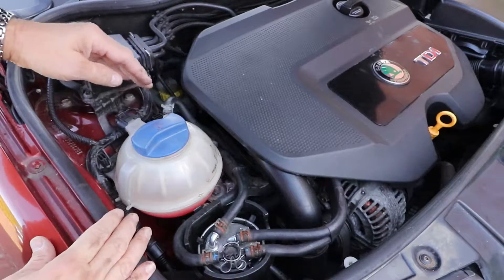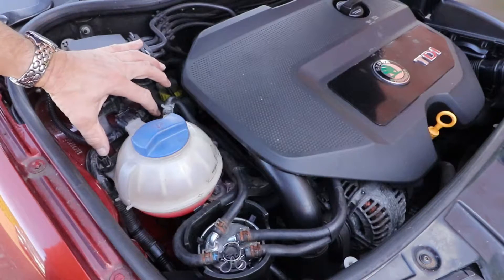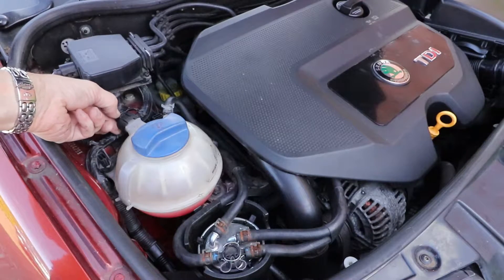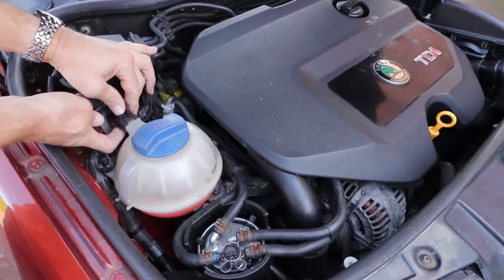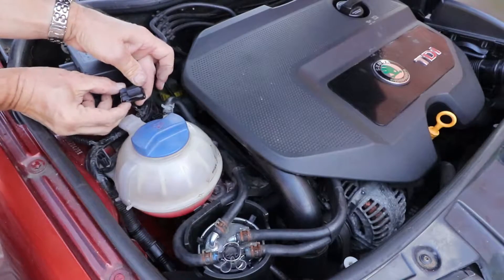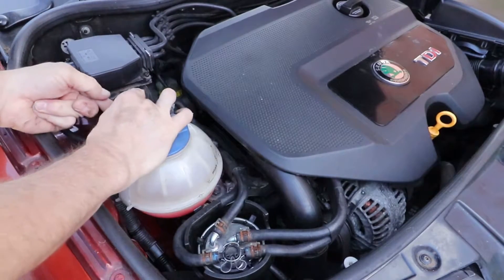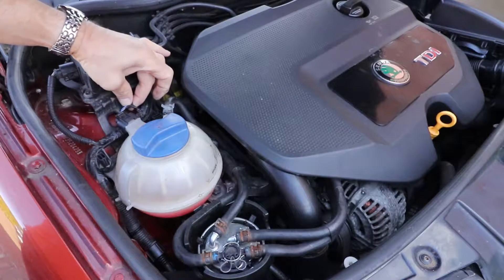The expansion tank is attached with two nuts under this plastic cable holder, and a locating slot underneath. But before you take it off, it's worth checking the connection onto the level sensor which goes into the bottle. To take the clip off, there's a little clip at the top and one underneath — just nip them together and pull it off. Make sure the connections are clean and it fits on securely, clipping into place, and check the wires going into the connection that they're not damaged or frayed in any way.